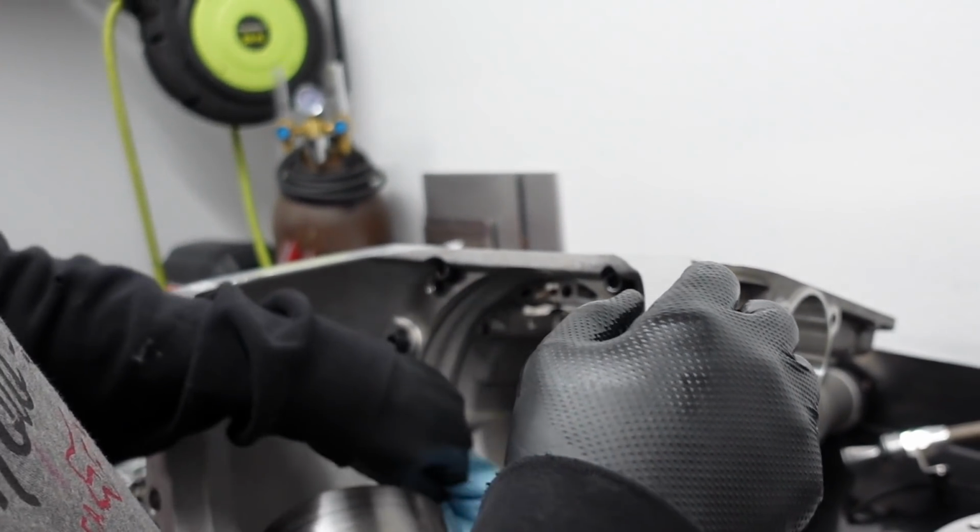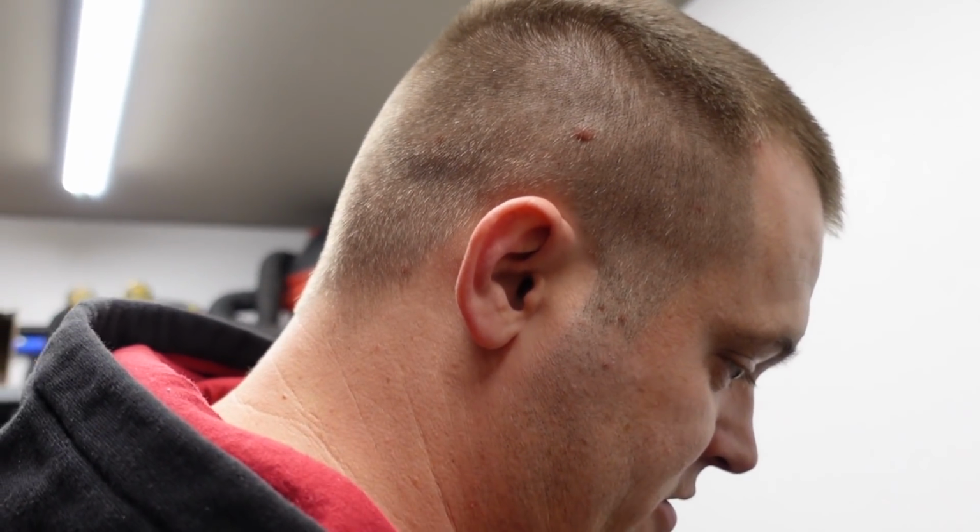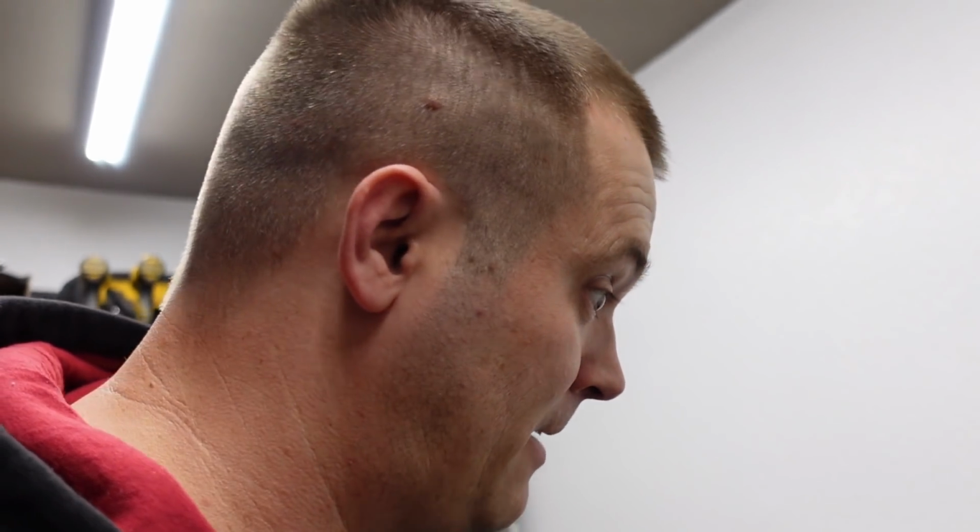So, hey, look. So, what we're doing here. Did you even tell them what we're doing? The reason for all this madness is Joe doesn't think my little small Coyote engine can spool a 98. I never said that. I said you need a bigger turbo. Oh, well. Yeah. So we have to drill the valve body for the dump valve. And then while we have it apart, we're checking the pump to make sure it's jetted appropriately.